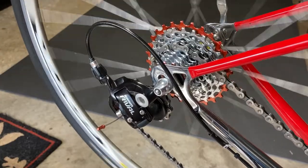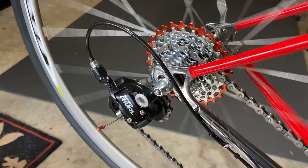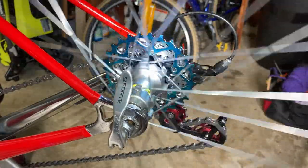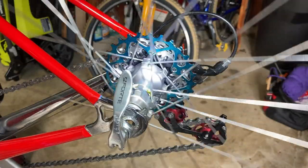Before you start coloring, your parts must be clean and grease-free. The big cog is a good choice since you can use a different color on each side. However, it is your cassette and you can color whatever cog you desire. To get a darker and more saturated look on the cog, just apply the color multiple times, letting the ink dry between applications.